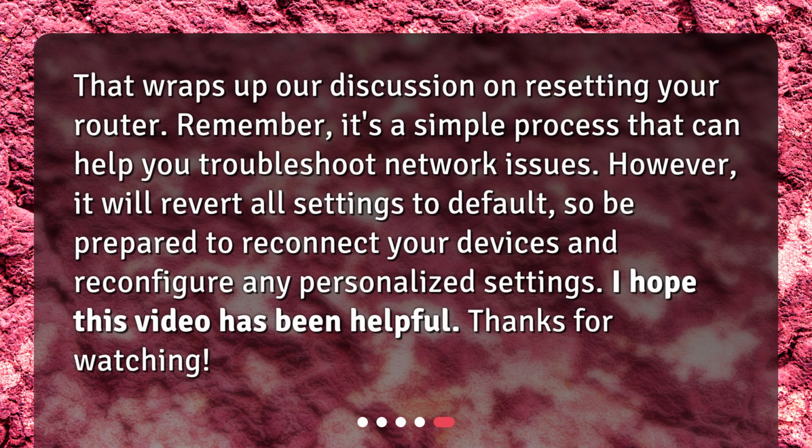That wraps up our discussion on resetting your router. Remember, it's a simple process that can help you troubleshoot network issues. However, it will revert all settings to default, so be prepared to reconnect your devices and reconfigure any personalized settings. I hope this video has been helpful.